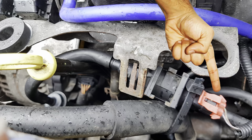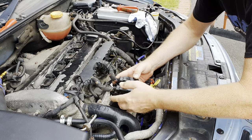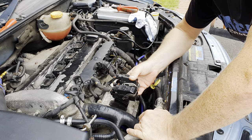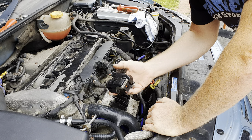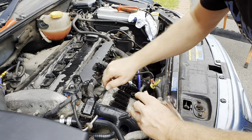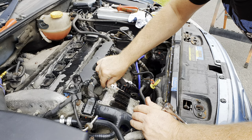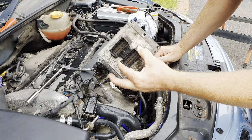Disconnect the harness from this valve and the harness from the MAP sensor. Disconnect the two large connectors from the engine ECU. If you've never done this before, I've already shown you how and I'll link to a clip for that in the description. Loosen and remove the four screws that hold the ECU in position, making sure not to forget that under the top right screw there's an earth connection. Recover the screws and lift away the ECU.